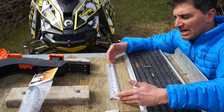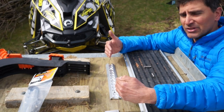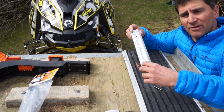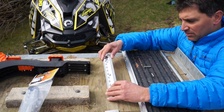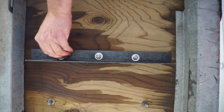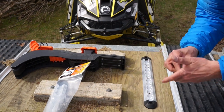I've figured out exactly where I want my Supertrack for the adjustability for my sled lengths. I've also moved it out roughly two and a half inches from the side of the track, which will allow my super clamp rear tie down to work perfectly. With this one foot section I've drilled three quarter inch holes, and now I can install those bolts, then install the washers and backing plate and tighten everything up.